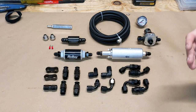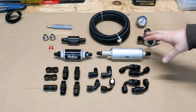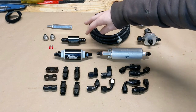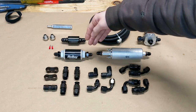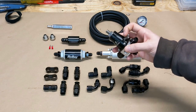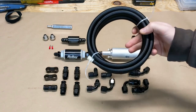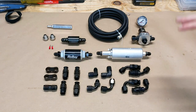The only downside is it draws quite a bit of current, so the charging system on this bike will have to be upgraded. Honestly, switching over to fuel injection on these older bikes, no matter what pump you use, you're more than likely going to have to upgrade the charging system. Our pre-filter is a 40 micron filter from Russell, and our post-filter is a 10 micron billet filter from Holley Performance. Our regulator is an AeroMotive compact boost referenced regulator. The fuel line we'll be using is a PTFE-lined fuel line.